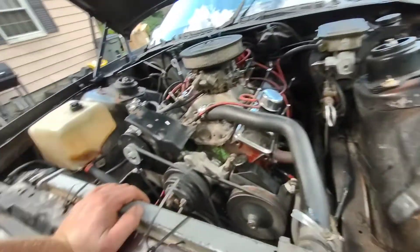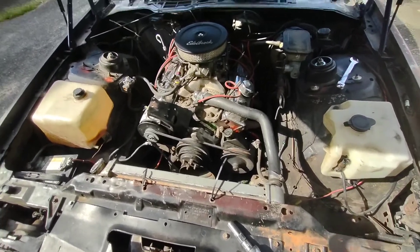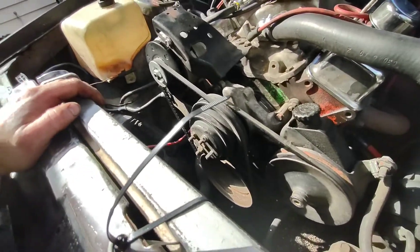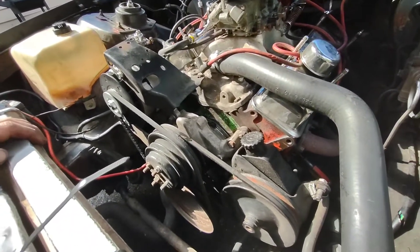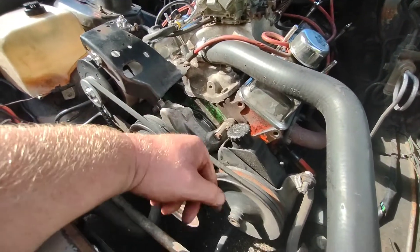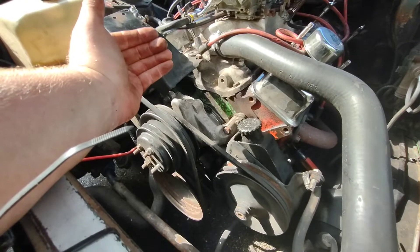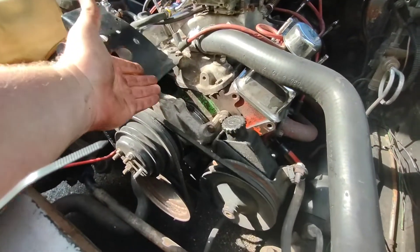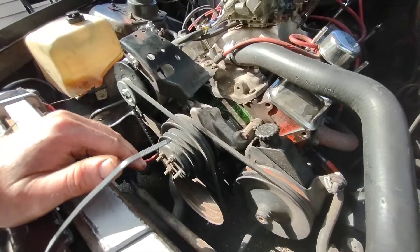So let's go get the white out. I think I figured out the other part of my issue — my timing is off by a good 10 degrees or so, because I marked them before and I was just off by 10 degrees. That could have been the issue the whole entire time of why it was just kind of falling on its face at wide open throttle. Not the whole issue, because definitely adjusting the valves, which I did in the last video, definitely helped. So now I'm going to go get my timing gun and we're going to re-time this.